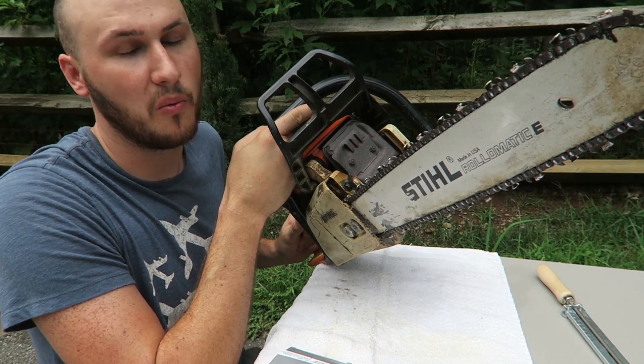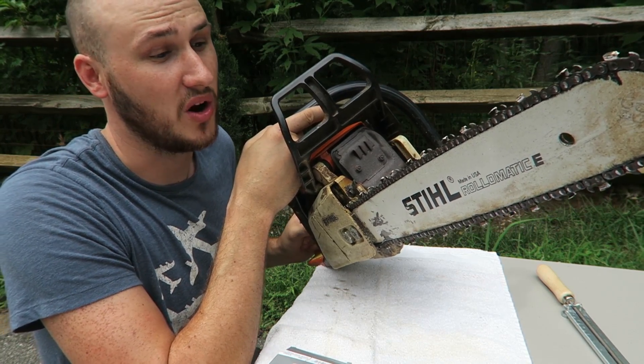It's also burning up the chainsaw. It gets so hot you can see sparks flying out, and it gets really, really hot and smoky. You don't want to do that because you're going to ruin your chainsaw. Make sure to sharpen your chain very well — you're going to save energy and make your job a lot easier.